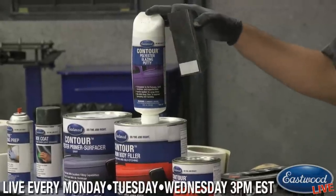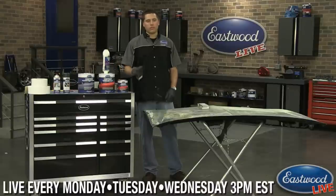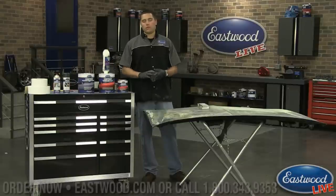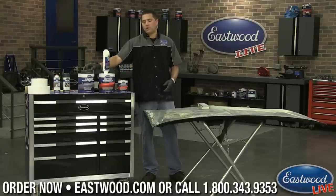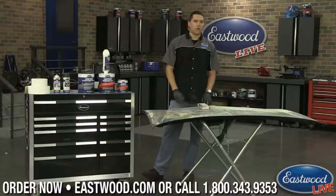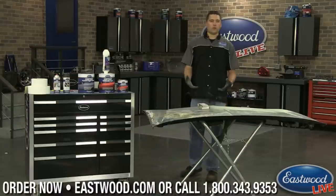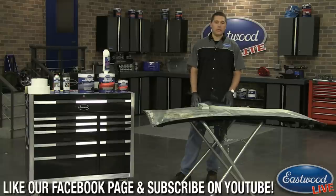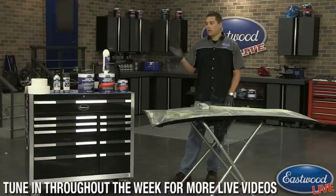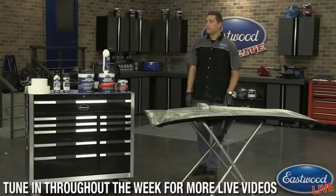I put a very small amount of this on, go back at it with 120 just to cut it open, then 180 to 220 to finish it off. And at that point, you're blended into the factory paint. You're not cutting into the corrosion protection. You're not going all the way down to the bare metal, destroying what the factory put on, especially on your newer model vehicles. That's where this really plays in, as all of them have an E-coat from the factory that's a superior corrosion resistance. If you can try not to break into that, you're way better off.